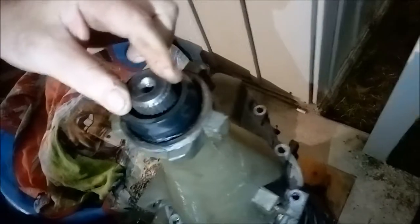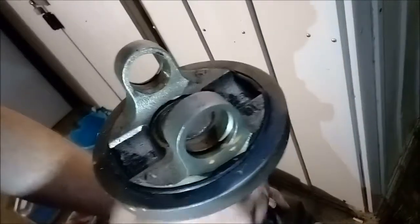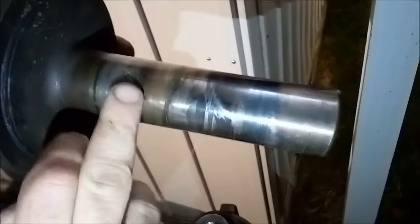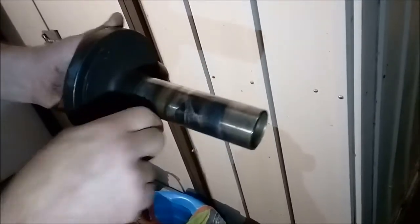If you take your yoke where the drive shaft is attached and you're underneath your truck with an extension housing on — like this top-mount style which is the more modern 4R100 setup most people should have — you've got your seal right here. This is the maximum amount of play you should have, right here. Mine goes almost all the way over to the bushing. This is the old drive shaft yoke, and it got so bad that it actually burned and scored the yoke — you can see a deep gouge divot right here.